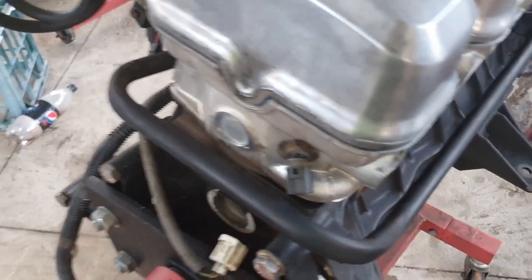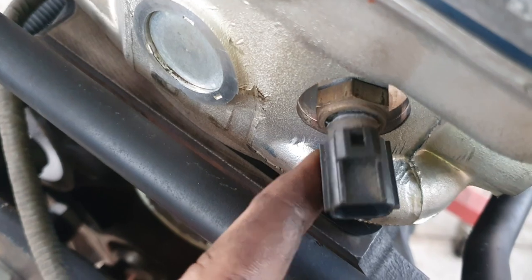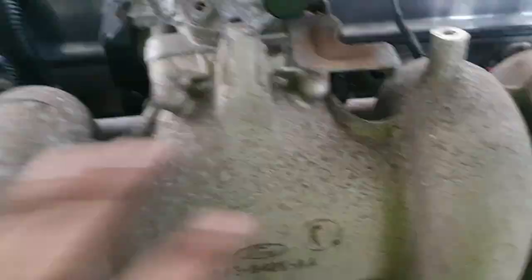When putting that pipe around the back of the motor, take off the sensor first and do it last — I just snapped my sensor stuffing around with the O-ring. The wiring loom is all tucked in nicely, leads bolted on, intake manifold sorted. I've got to make a feed line — might buff it with the wire wheel to make it shiny.